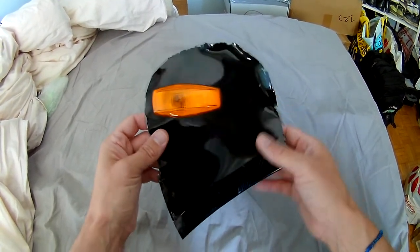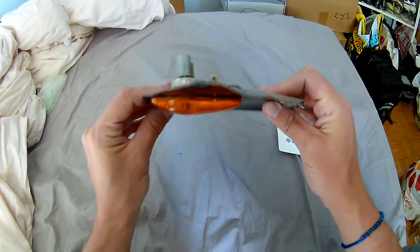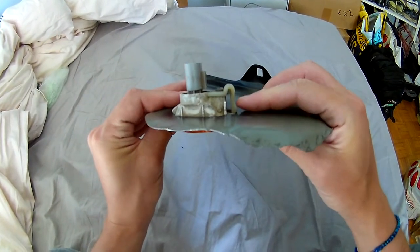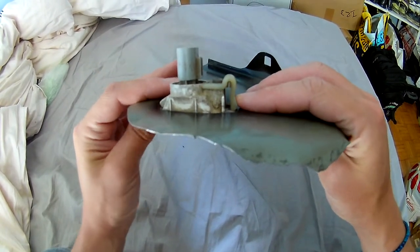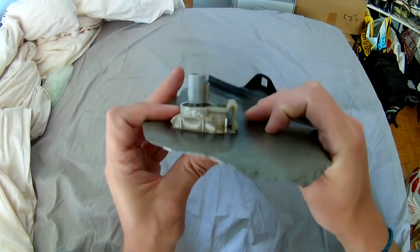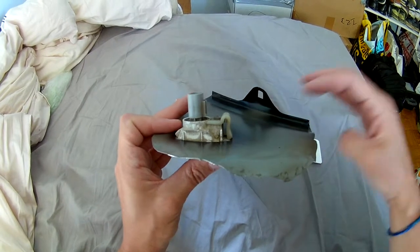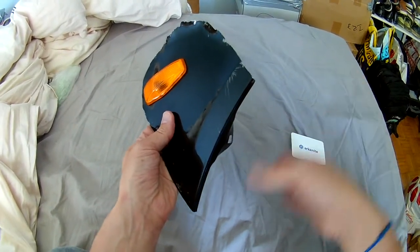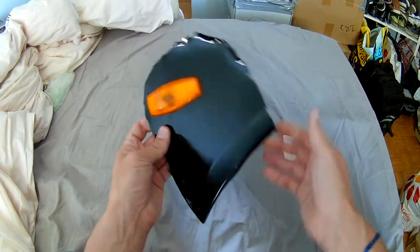Here's your side blinker — the front of the car is on the right in this case. Behind you can see that it is retained by this plastic clip. To remove it, you just have to push that clip and it goes right off. The best possible way to do it would be to push directly here. It can be done by removing the plastic arch around the wheel, but that would be a lot of pain just to remove a blinker.